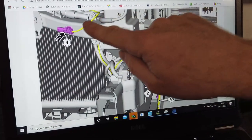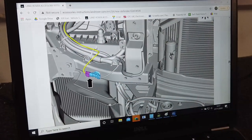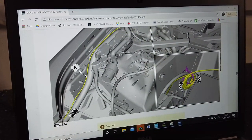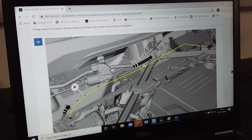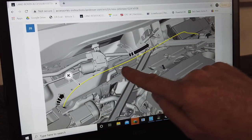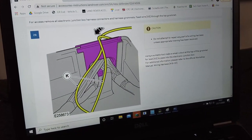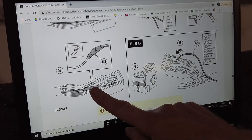They're telling us to route the cable out to the gray box and then run the other lead all the way up inside the wing parallel to the main battery cable, then into the rear bit under the windscreen cowl, through a hole in the bulkhead, and along the top of the bulkhead. You've got to take your wiper blades, wiper arms, and the cowl off. Then it zips along here, you find the fuse box, open it up, and it tells you which two connectors - you route it through the rubber bit, unplug the connectors, take the connector apart, and cut into the main loom.